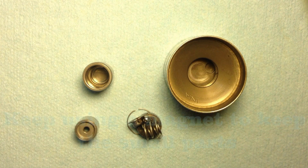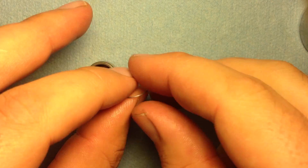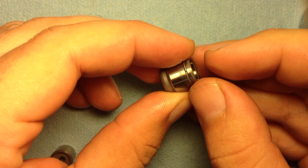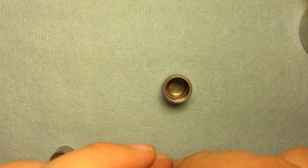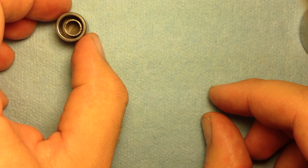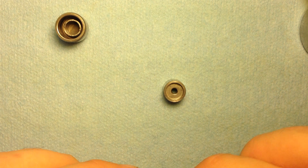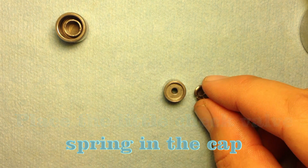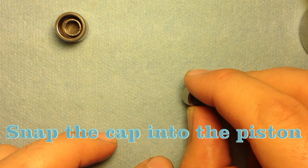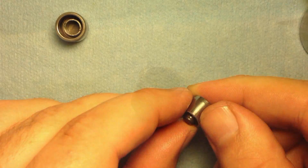Assembly time. Notice I'm still using the magnet to keep the small parts because they will roll around your bench and get lost. First thing I like to do is put on the little retaining ring — no special tools needed, it's pretty light pressure, you can do it with your fingertips. Next, the check valve spring just gets dropped into the little pocket of the cylinder. Now we're going to assemble the check valve: I put the spring in the cap first and the ball on top, then snap the piston over the cap — just a little wiggle and it snaps right in.